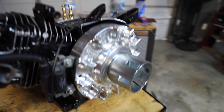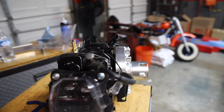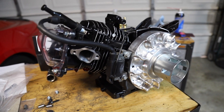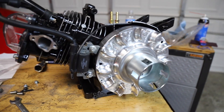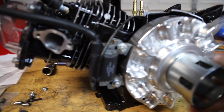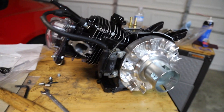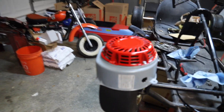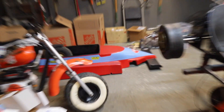This thing is pretty much good to go — still need to add oil, I believe it was like 16 ounces. This thing is really rad. Got the coil on, and on these billet flywheels I just push the coil back as far as possible. On a race bike we smoked that coil even gapped to ARC spec, but it still makes a really strong spark all the way back, so I don't feel like it needs to go forward. Here is our engine cover — it's kind of a blueish gray color, looks really blue on camera but it's actually really gray. It'll be a nice accent to the blue on the cart.